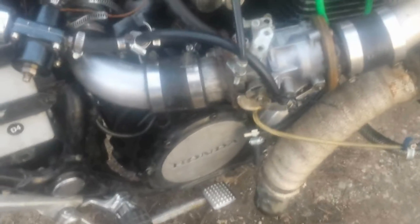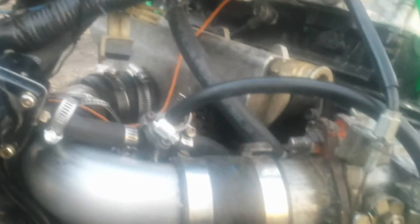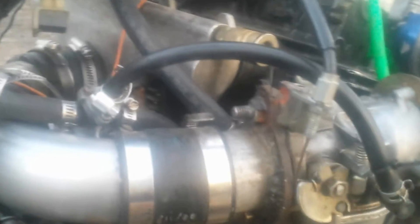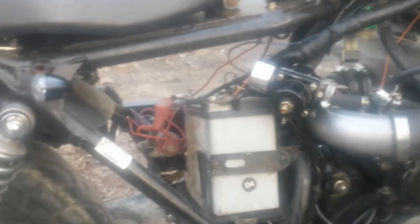The turbo's off a Volvo. I've got my fuel return line, which lets the whole system work — otherwise the fuel would have nowhere to go. I've also got this other pressure regulator on here, which is also boost sensitive. Like I said, this is all a mock-up right now.